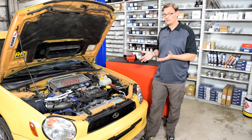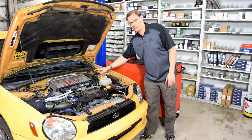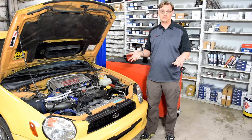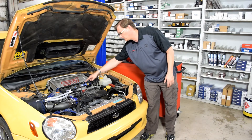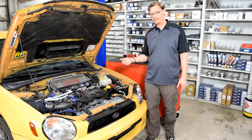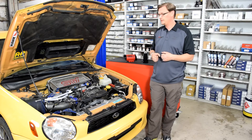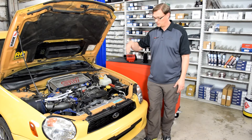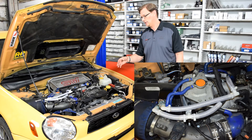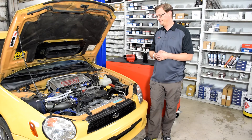On the EJ series Subaru engines, pretty much across the board, there are two ways for vapor to get into your turbo inlet. The first and easiest to see — especially if you're looking at the intercooler — is this metal hose here on the front. There are rubber hoses on either end; if you follow those down, they go right to the valve covers. They come up from the valve covers, tee right here, and move into your turbo inlet hose. The second one is harder to see — it's on the back of the engine block, right in front of the compressor wheel of the turbo. It comes up and there's a little tee there; that's where the PCV valve is on pretty much all the EJ series engines, and then it goes into the turbo inlet hose. What we've done is intercepted both of those sources and sent them to the catch can, with one return from the catch can back to the turbo inlet.